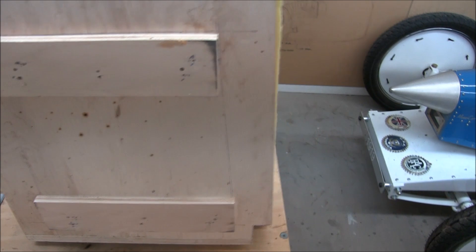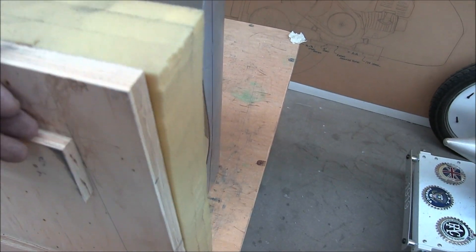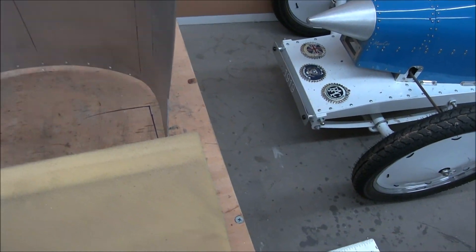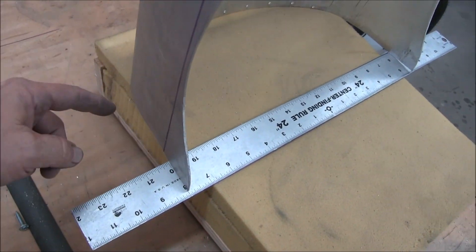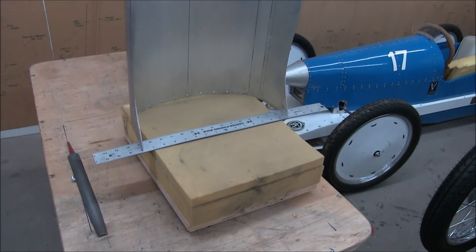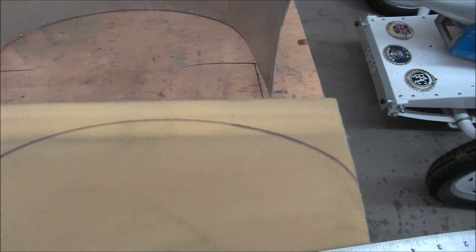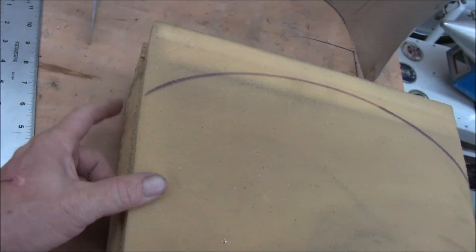The bottom of the seat is notched for the brake line. The whole idea of this plywood is so that the fabric can wrap around and staple along here. These are one inch thick so that's a three-inch foam pad. I've centered it up over the foam and made a mark — I'm going to use the bandsaw to cut that. I can cut through the plywood and the foam all at the same time.